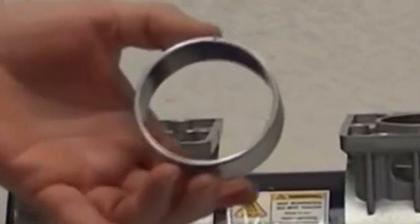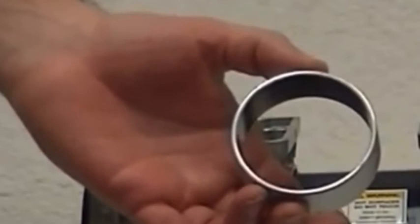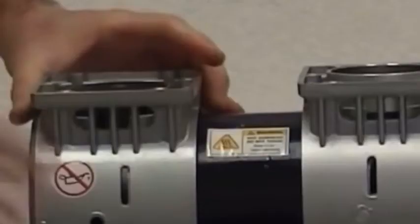They have a cylinder ring with Teflon coating, which allows for less friction. Because the cylinder is so short, it appears they're trying to limit the amount of friction occurring at the cylinder wall, probably to preserve the Teflon coating. They're doing this by limiting the RPM — in comparison to a standard compressor, it's probably running close to half the RPM. Less wear and less noise, probably in comparison to a motor that doesn't have oil or a Teflon coating.